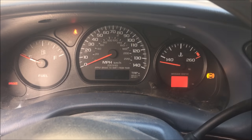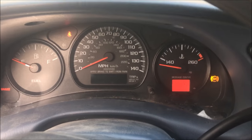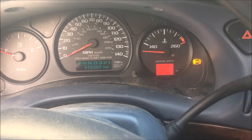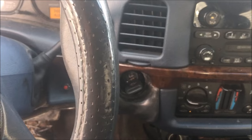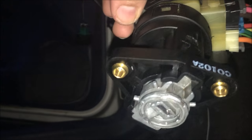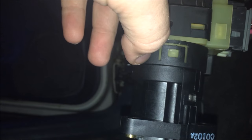As you can see, it goes through all your lights and the security light and everything comes on, so I think I messed up something in there. I'm going to have to take this out and bypass the theft deterrent system. If you replace the lock cylinder, you'll have to actually program the car for the passkey system or bypass that system.